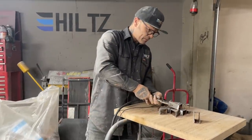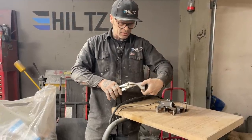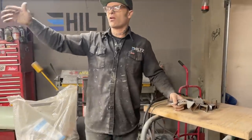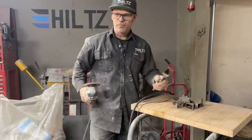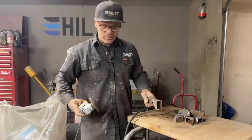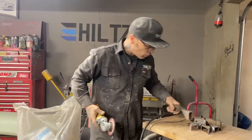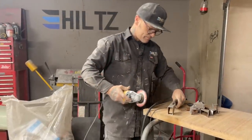To me, the fastest way to build a car is to put something in place and then build to it. And that's what I'm doing with the floor. The cross members are already there, and I'm building to it. I'm not putting something in there where I can't see from either side if I take the body off. I want to be able to drill all the holes while the body's on there, so it goes off and on. You can see it.